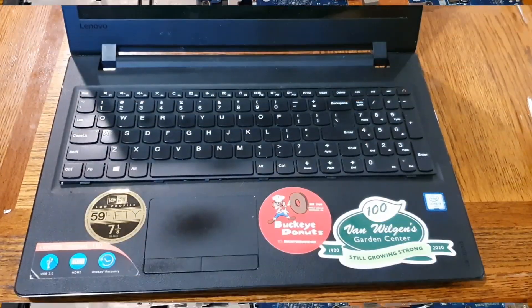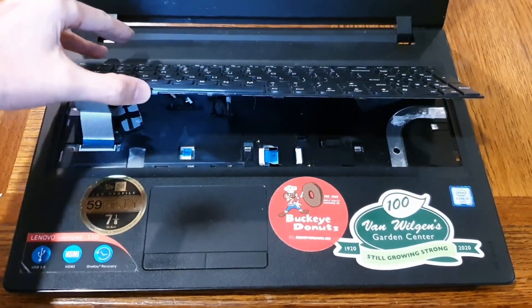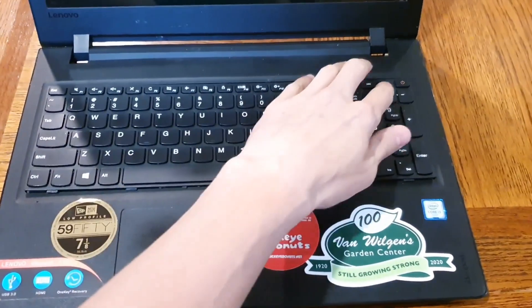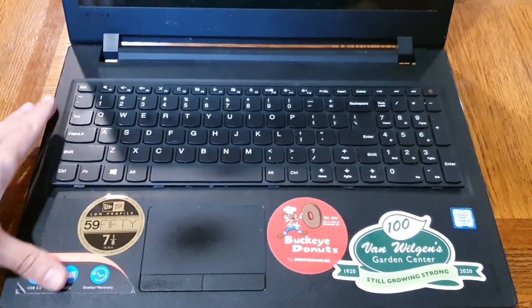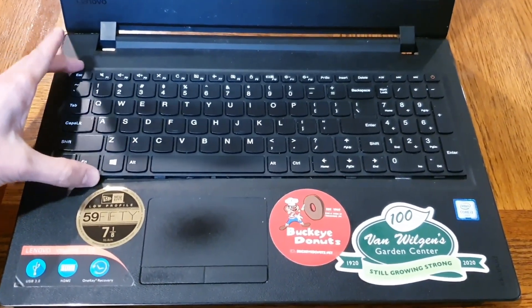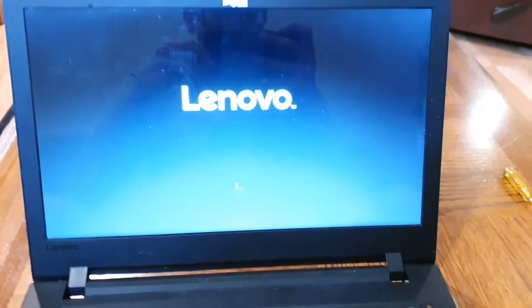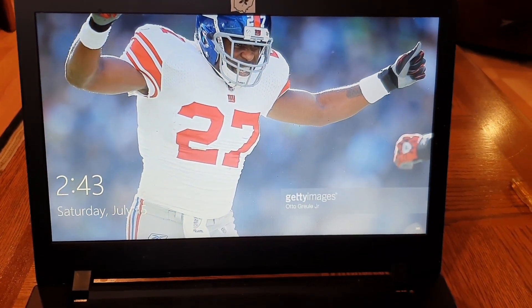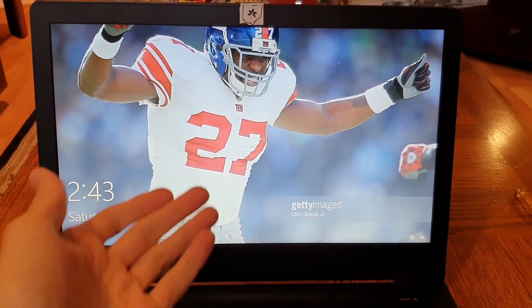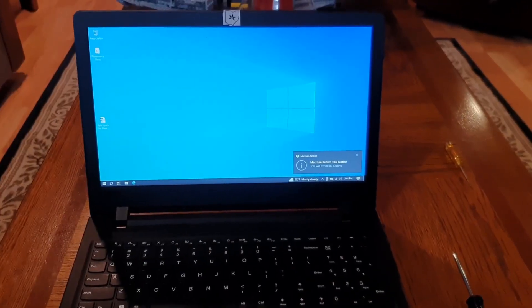The back plate is on but screws aren't in yet. You'll need to reattach the ribbon cable for the keyboard because the power button is on the keyboard. I haven't put the optical drive back or all the screws back — just closed the back cover and reinstalled the keyboard. The battery is a bit shot so fingers crossed it has enough charge. And there we go — it works! That's my brother's background, Brandon Jacobs, one of his favorites. Success!